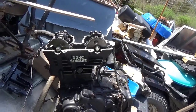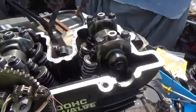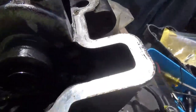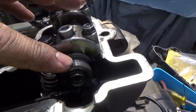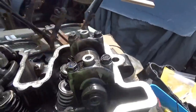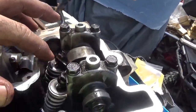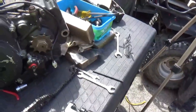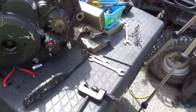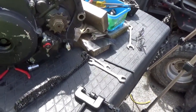So we took the chain apart, fed it through, and did all that — and it was all good. By the way, this one was tighter than it should have been, and it turns out the valves were dragging. I want to mention that — I readjusted the valves on this side; this side was fine, it was nice and loose, but that side was dragging, the followers were too tight. Fixed that. Anyway, the chain is fed all through, and I've got my little extender wires to make sure nothing falls into the case. Now it's time to put the pin back in — that is not the easy part.